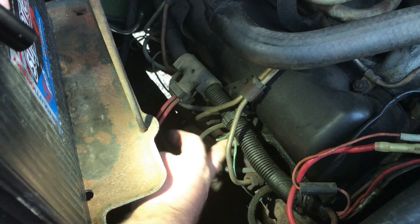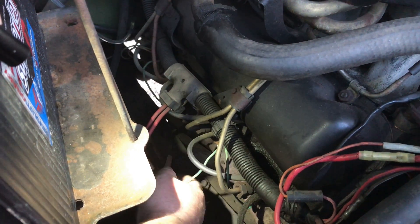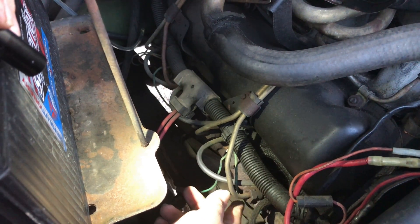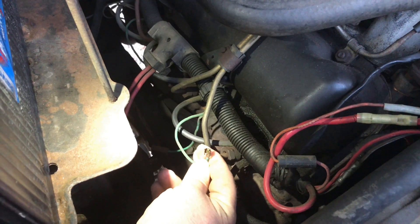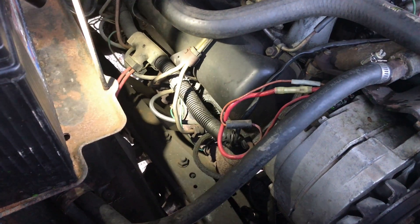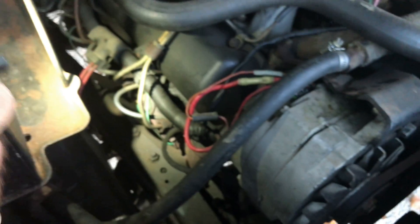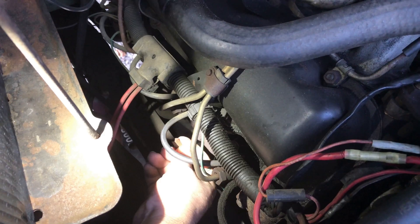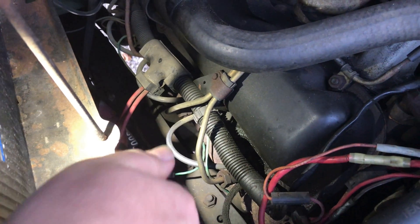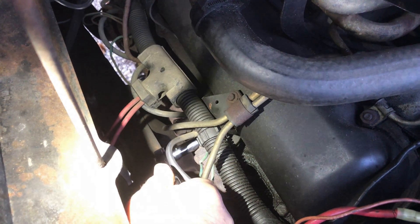Now, where the glow plugs are located — on each side of the engine, you'll see a wiring harness there, and there's going to be four wires coming down, two in the front and two in the back. Those wires plug right directly into your glow plugs. If you have a problem finding them, just trace your fuel pump lines down from the fuel pump on top of the engine to your injection pump, down to the fuel injectors — and the glow plugs are normally right underneath those. They're kind of hard to see. These use a 3/8 socket to remove them — you'll need a deep-walled socket. Yours may have a little larger size, maybe 7/16ths or so, or if you've got some import parts it might be metric. But these are the GM factory parts, so these are 3/8ths of an inch.